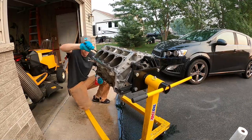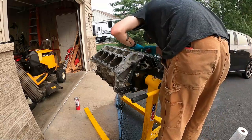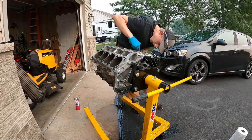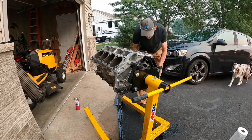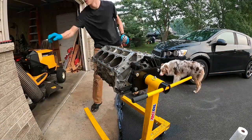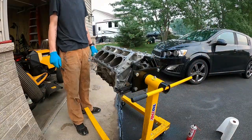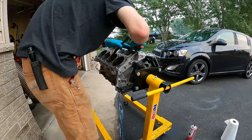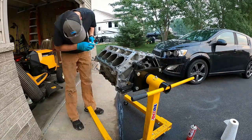All I'm doing here is getting most of the oil, dirt, and grease off because I'll be coming through with some other tools later on. I'm hitting it with the brake clean getting all that dirt and grease loose, hitting it with the brush, and then rinsing it off again with the brake clean. I also end up hitting the cylinder head surface with my carbide bit scraper — which is nice and precision flat — to get all the old head gasket material off.